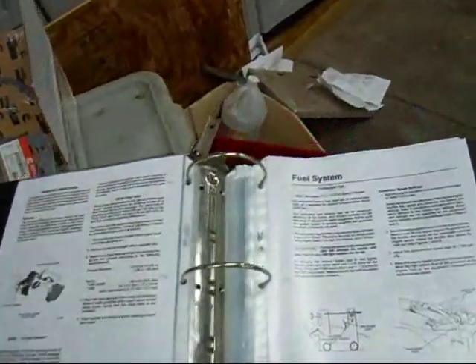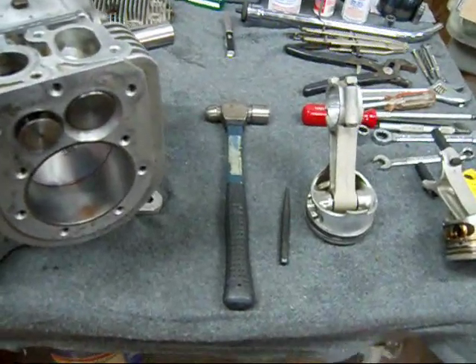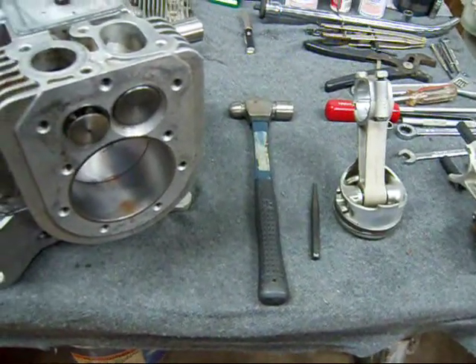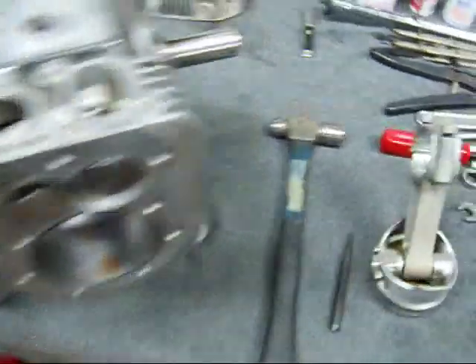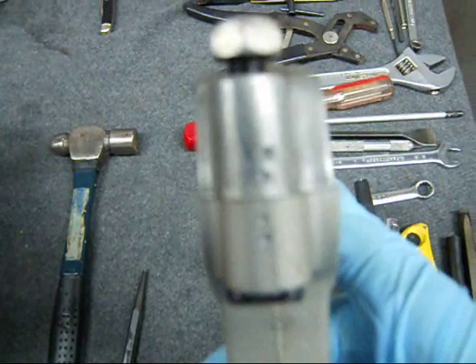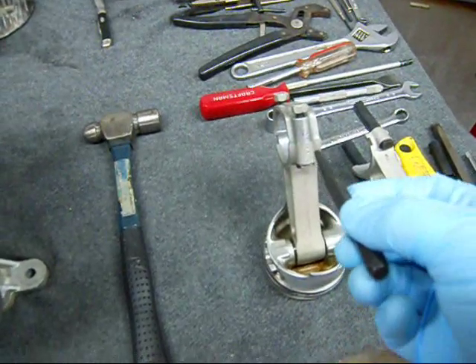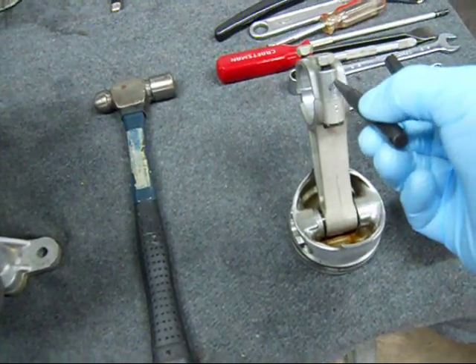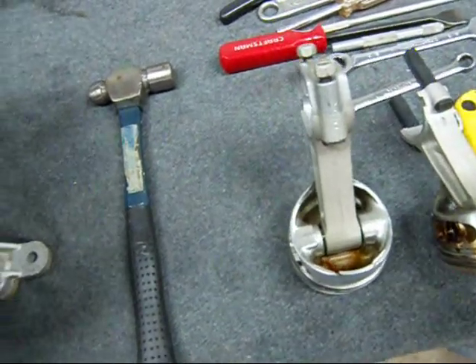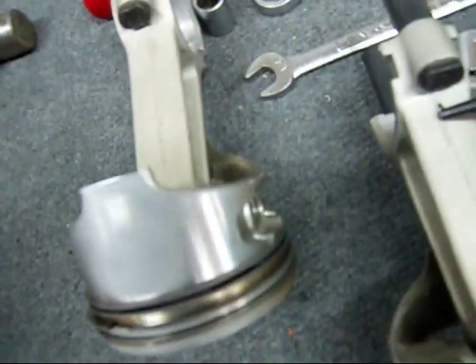It's best to have the manual right with you, not in the house — when you're out in the garage, have it with you. There are a few things I found helpful when you assemble your engine. An old mechanic told me this: as soon as you get the parts together, take your punch and punch maybe two marks on the rod and the end cap, or rod cap.